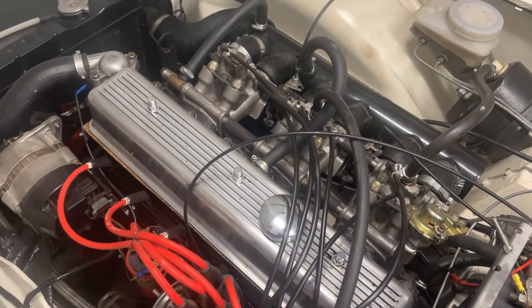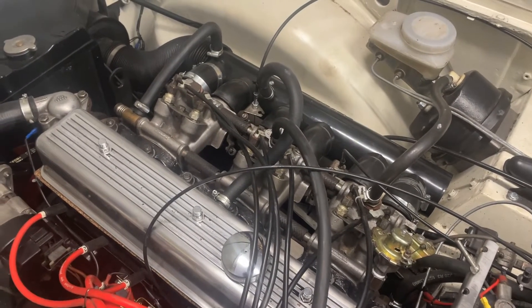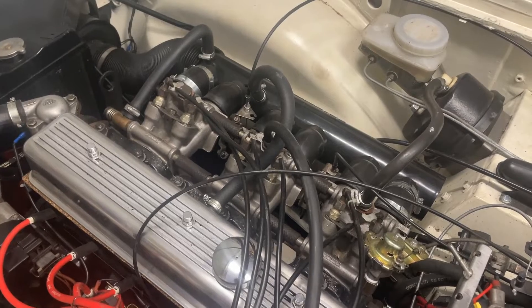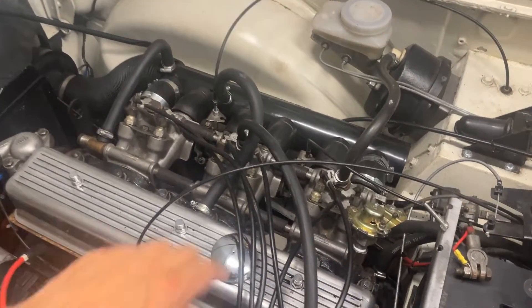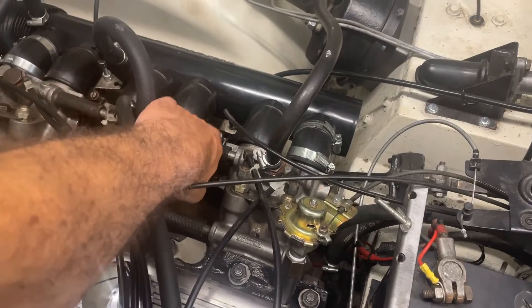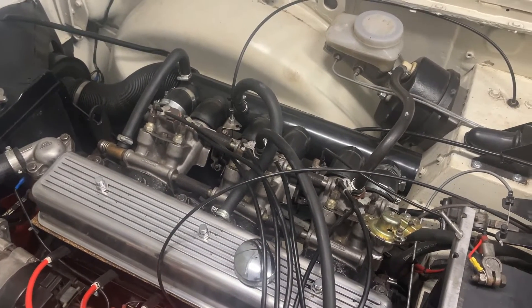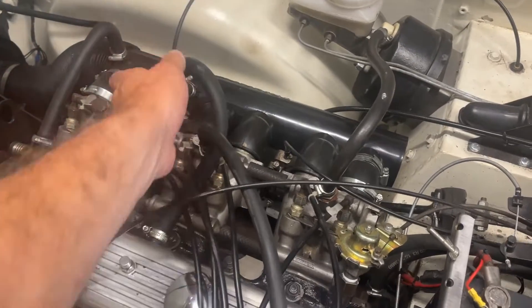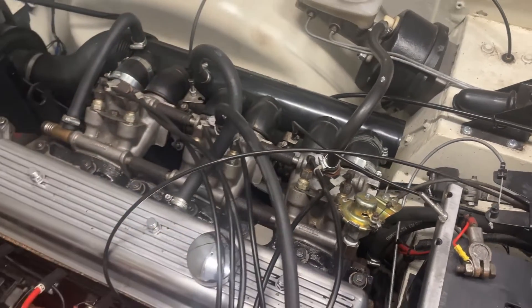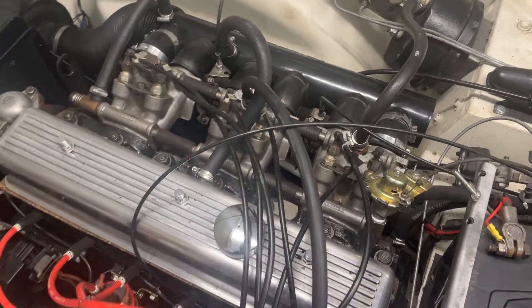On a TR6 the engine breathes through the top cover, and that goes into the plenum on a PI unit, or probably into the manifold on a carburettor setup. But one of the downsides of that is upstream — over here in the middle two combustion chambers — I'm finding that the plugs are a little bit sootier, showing that whatever's coming through this pipe is getting pulled back in.